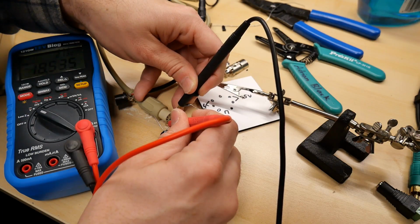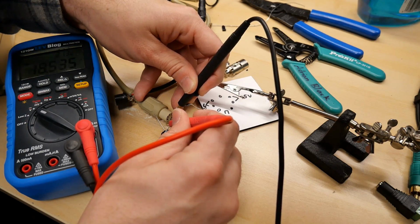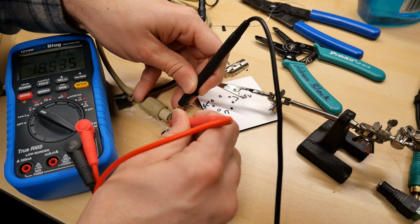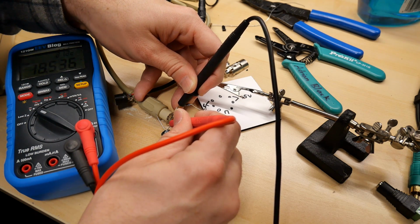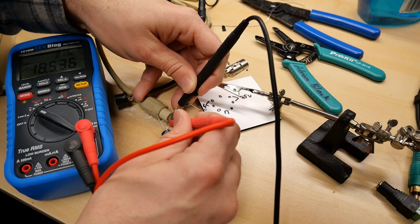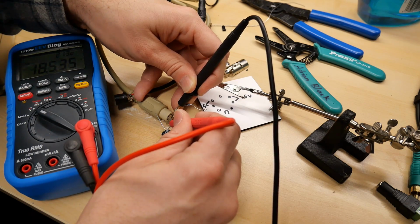So this is a 2C power supply. We're getting 18.5 volts. That would mean this is an unregulated power supply. It's just a transformer with a bridge rectifier. So we're getting some DC, probably a capacitor for some smoothing, and that's it. So it probably goes to around 15 volts under load. But yeah, that just means that the power supply on the 2C is pretty accepting of a wide range of voltages.